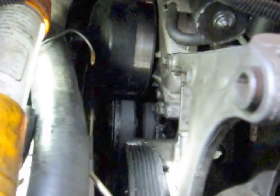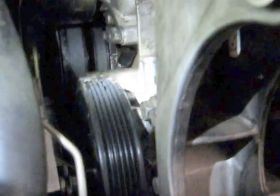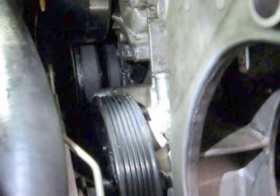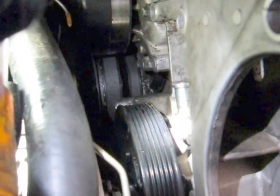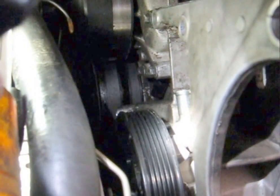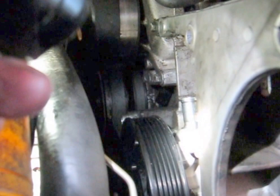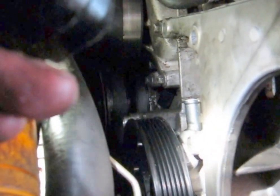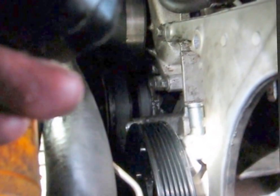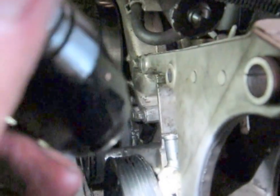However, I don't think I'm going to be able to torque those two bolts that are behind the pulley — the ones I've been calling captured. I think I'm going to pull this out and put a little blue Loctite on there. With an open-end wrench I can probably get them to maybe half that torque spec. I can't get a box wrench on there either because it's just too tight to the pulley.